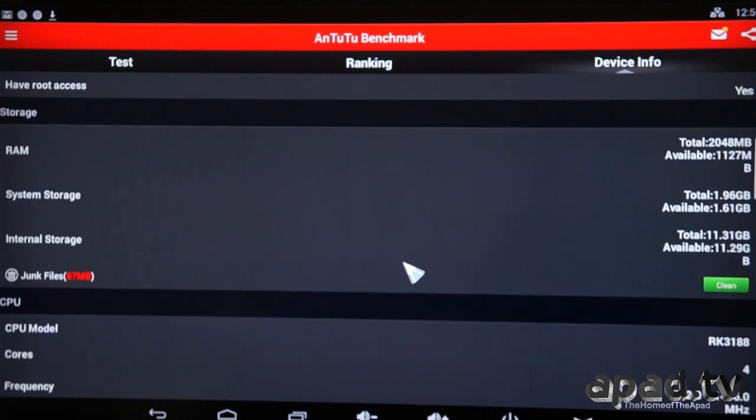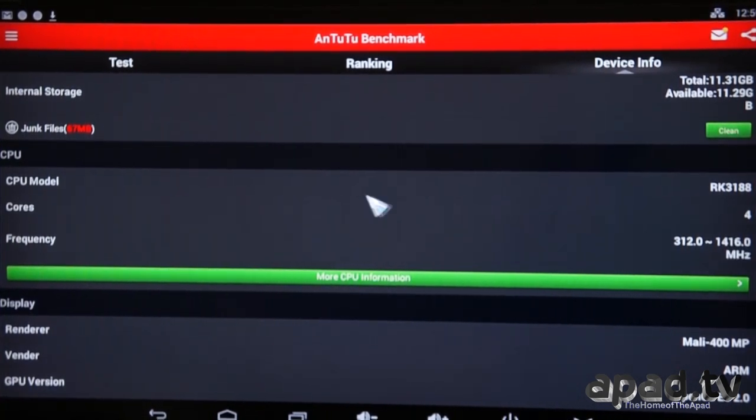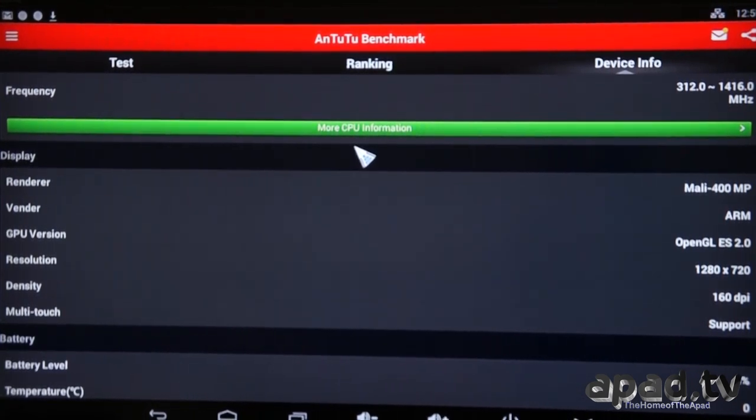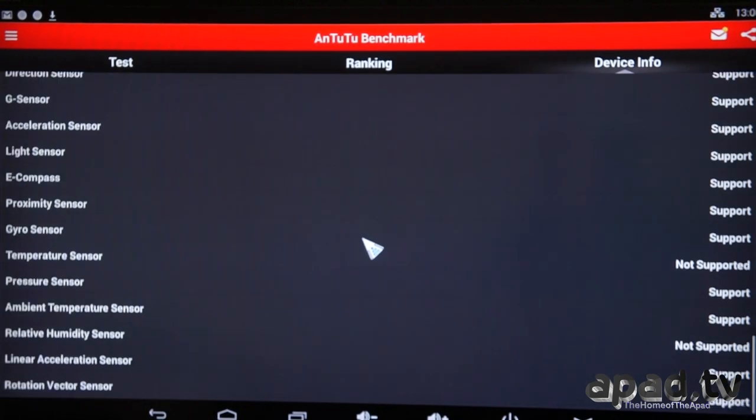The specs show 16GB storage, 4 cores running at 1.4GHz — the exact speed stated in the specifications. A lot of device descriptions will give you the rated speed of the CPU, not the actual speed it's configured to go at. In other words, with custom firmware or a CPU overclocking app, you could change the speed. But that doesn't necessarily mean when you're purchasing a product and it says 1.6 or 1.4 GHz, it's actually going to be running at that. With this product — the M8S — it's actually running at 1.4GHz, which is what is stated in the description. I think that's all the interesting AnTuTu data.